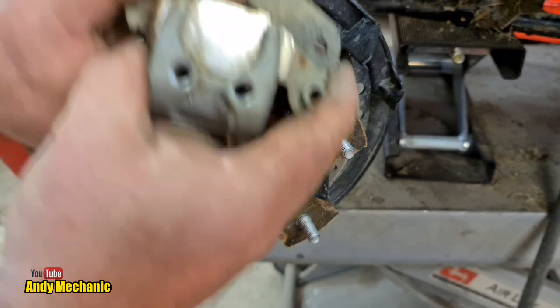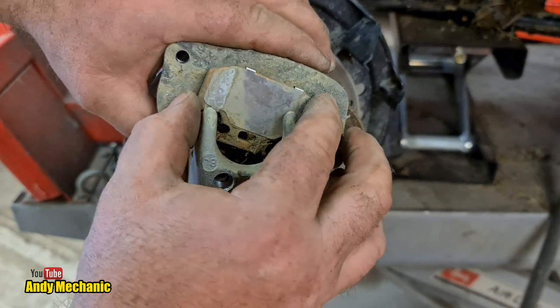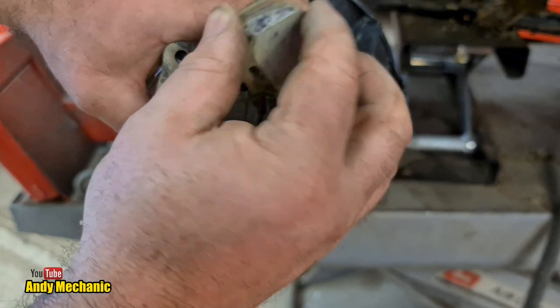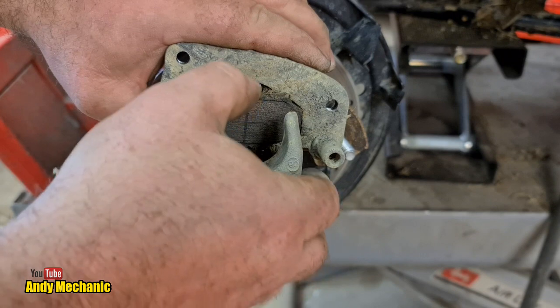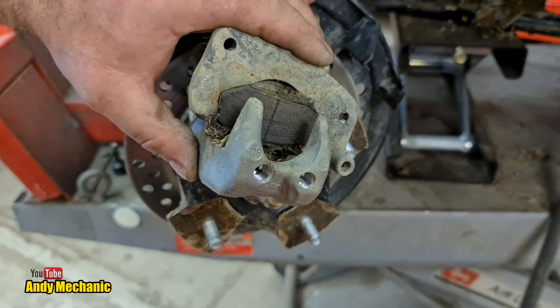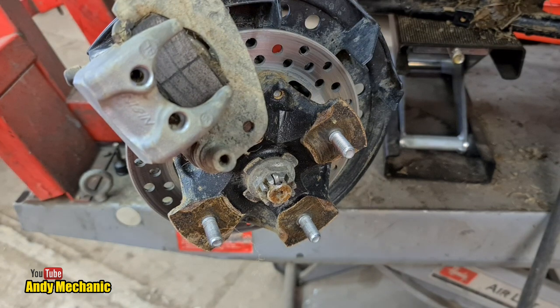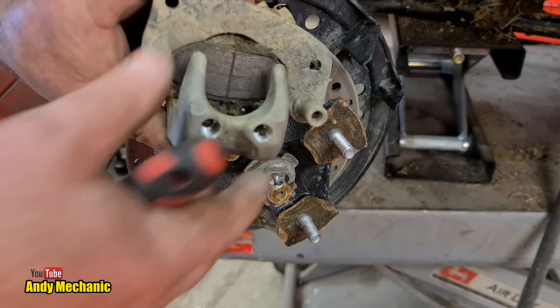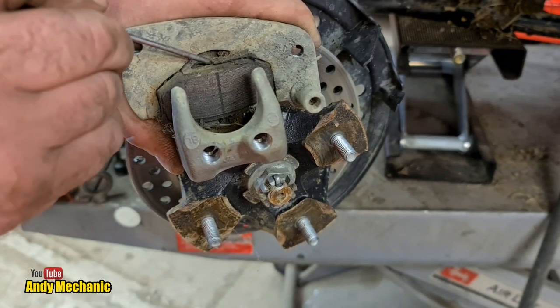Just flicking the caliper over a little bit. We've got the outer - sorry, the inner - that's in pretty good nick, it should last to the next service I think. Look at the inner one - I need a flat screwdriver. If nothing else we can get all the dirt out of these brakes and that will help the pads to last a bit longer as well.